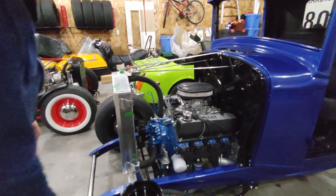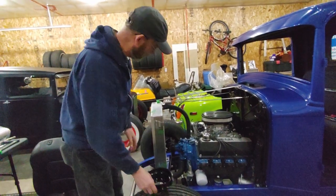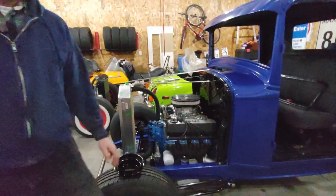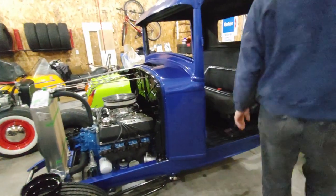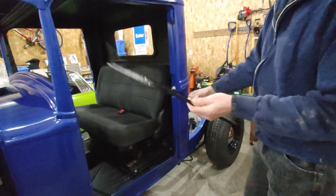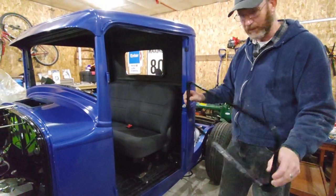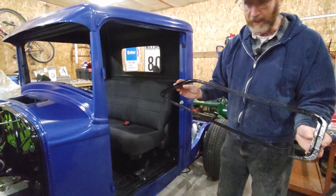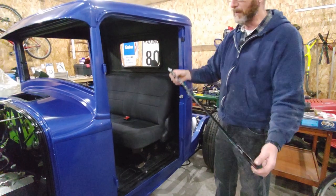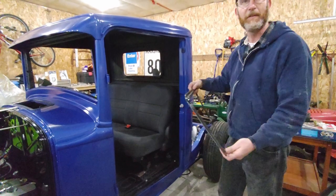Another thing I did was I took some parts - I will insert some pictures. I sandblasted some of the pulleys and painted them, along with the original rear window frame. It's kind of pitted but I thought it was cool just to use the original, so I sandblasted it, epoxy primed it, and put a coat of black paint onto it. It's all been straightened out - it'll go in there and work. The texture is kind of cool so I'm gonna leave it just as is.